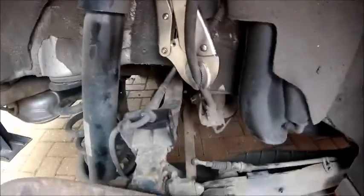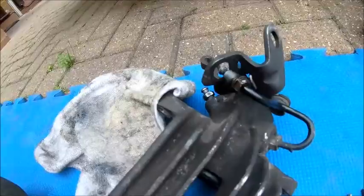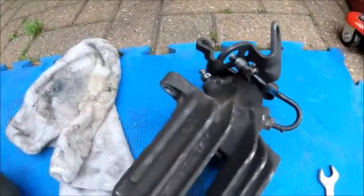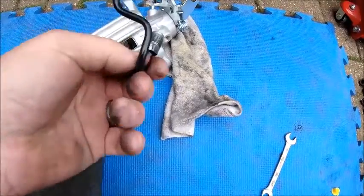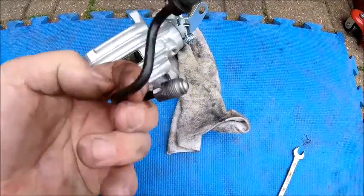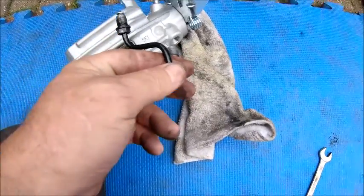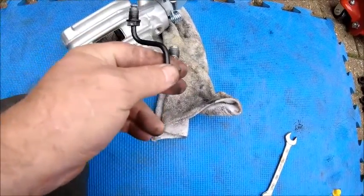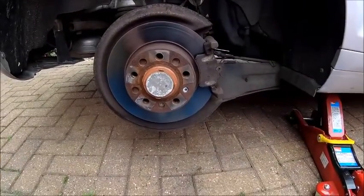Okay, wheel off. Obviously the pipe is still up there, clamped off. All I've got to do from the old one is drop that pipe off there, put it on the new one, and should be good to go. Luckily that came off drama-free — I don't need any more drama now, as you can tell from my last video I was a little bit dishevelled to say the least. Right, let's get it bolted on — a couple of bolts to slap it back in place and then bleed it up.